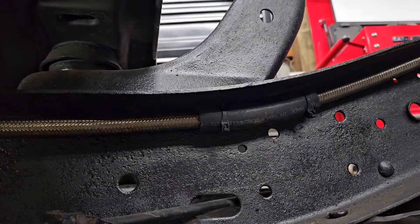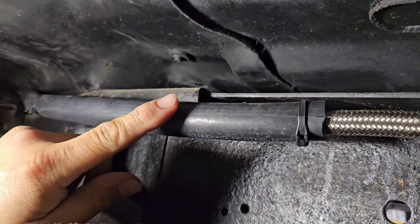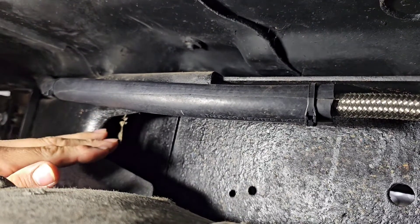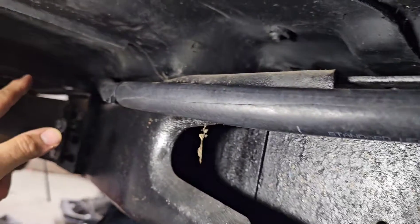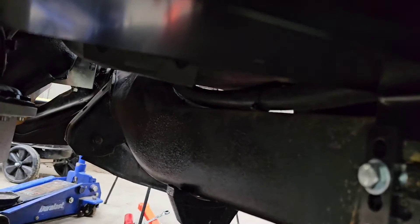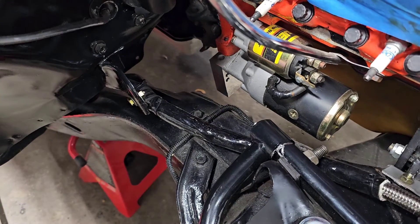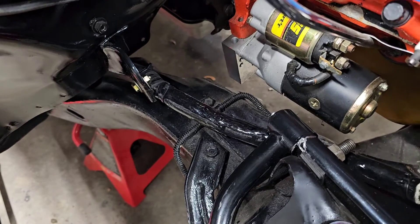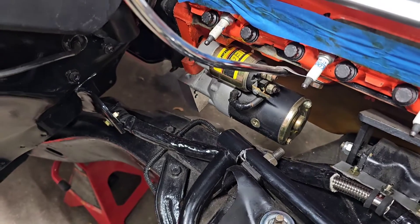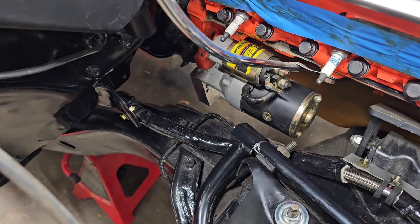From there you see I have it wrapped close to under the frame, but it's not really touching - I can get my fingers in between there. Snaked it around there, and here is where we started the heater hose again because this is where the frame gets boxed in. We ended up going up and around the cross member for the transmission because our headers will come through there, and then we ran it up through the front of the cab. Underneath the cab it's a nice little path through there to the front. From the firewall, we have the line wrapped in the fire sleeve. I snaked it around so it wouldn't touch the control arm - the fire sleeve should hopefully help keep heat off of the 8AN line and fuel inside the hose. I'm going to put the smaller version on the brake lines too, and use some on the trans-cooler lines when I do those.